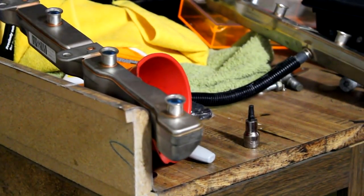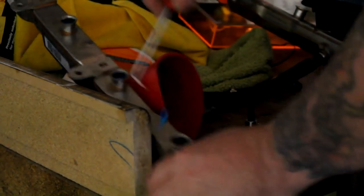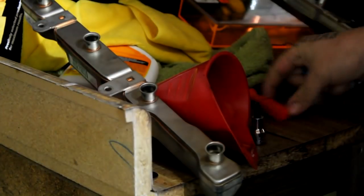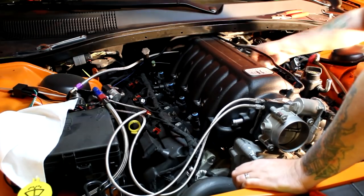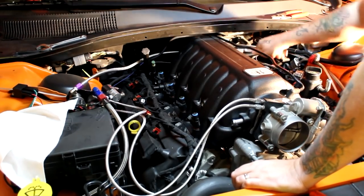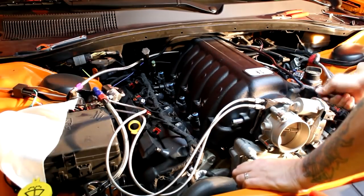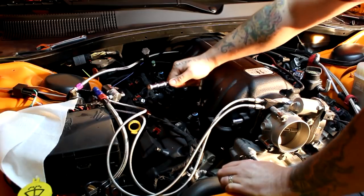Once we pulled the injectors out, none of the O-rings came out of the rails. In order to use the new rails that we just got, we have to fish the O-rings out. A lot of the heads on these bolts strip up on the reviews, so we're going to go ahead and just take the ratchet to them real quick, and make sure that we get a good seal because we don't want to have a leaking intake. Once we put the fuel rails on, these are no longer going to be accessible, so it's best just to nip this in the bud while we can.